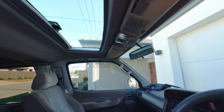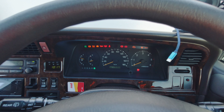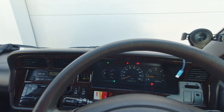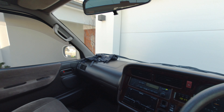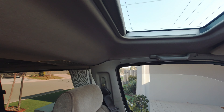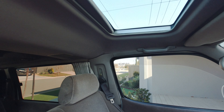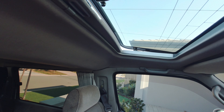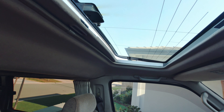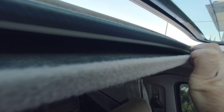Let's take a quick listen. We've just driven a few kilometers so the engine's up to running temperature. The rattle seems to come from over here somewhere, and if you open this it gets much louder. I found that if I put my hand up here and push down on this metal tab back here, it goes away.